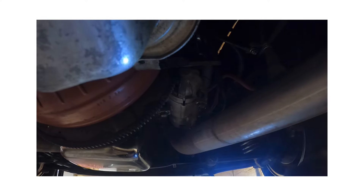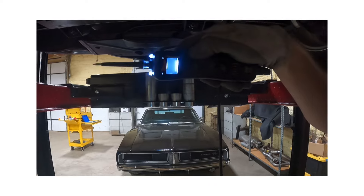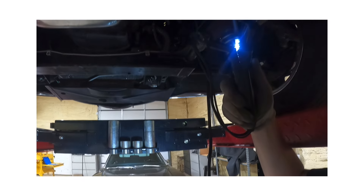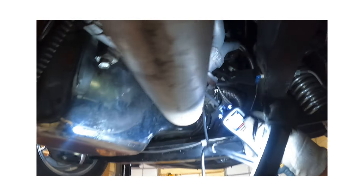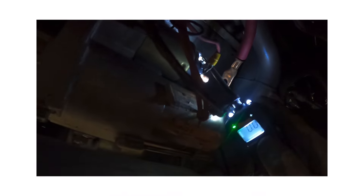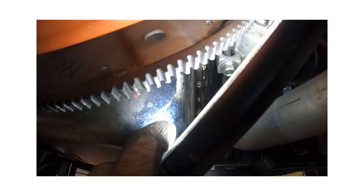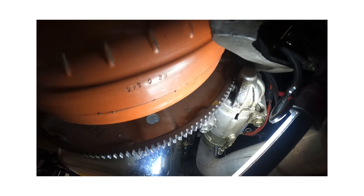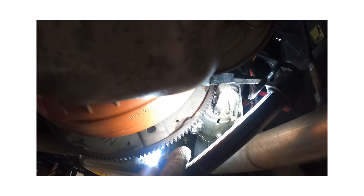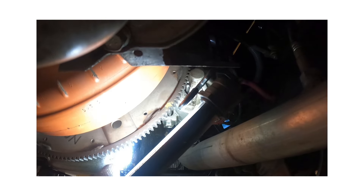This is how I check on a GM. I take my battery and use a power probe — power probe is your friend on any kind of old car for electrical work. I've unhooked all the wires and the battery is disconnected from the car. I put my ground probe from the power probe onto the starter, and all I want to do is engage the solenoid. Now I can actually see where the starter is shimmed out away — it's too far away.